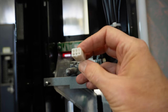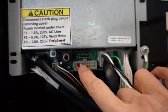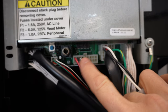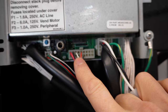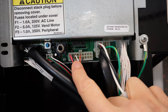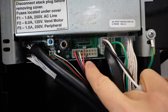You have to make sure that you've got the MDB plug. The MDB plug can be easily recognized by its six sockets — there are actually five pins, but it's a six socket plug. This is the MDB harness connected to the main control board, so this is what it looks like. You can look at your control board; if you have this type of plug, then you're more likely going to be running MDB. These control boards can also run the 110-volt older style coin changers and dollar bill acceptors — the plug would look a little bit different, with more wires running it.